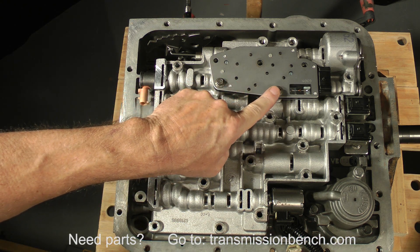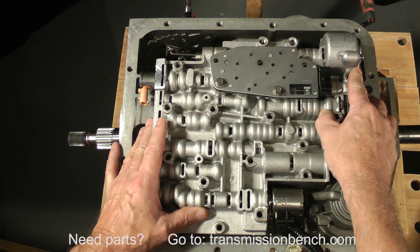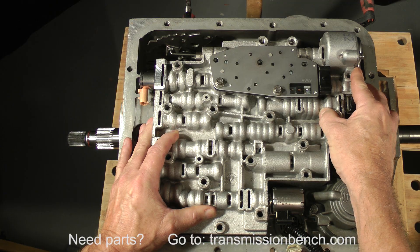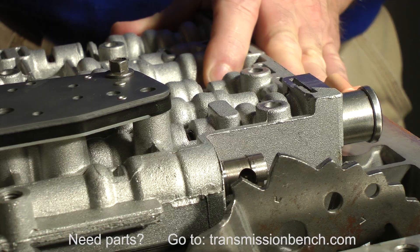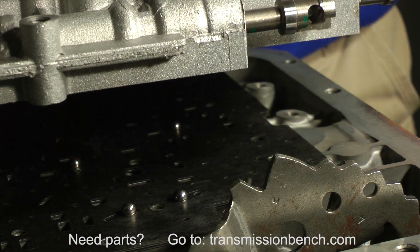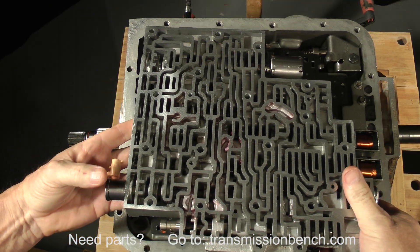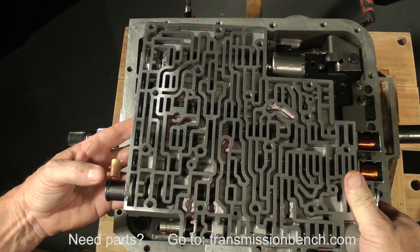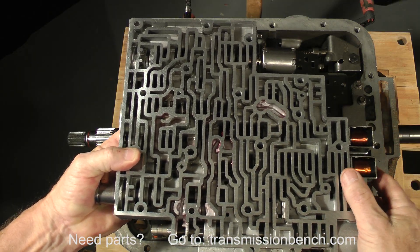Place the 14 bolts and the bracket with the other small parts. Notice that we didn't remove the 8mm bolts here — they are much shorter and used only to attach the manifold pressure switch. We can now lift the valve body, but be aware the gasket underneath may stick to it and tear. It's okay if it does. Lift it straight up and let the manual valve link fall away. Carefully turn it over. If part of the gasket is on the valve body, just leave it for now. As you handle this assembly, take care not to damage the 3-2 and shift solenoids. Gently place it in the pan.